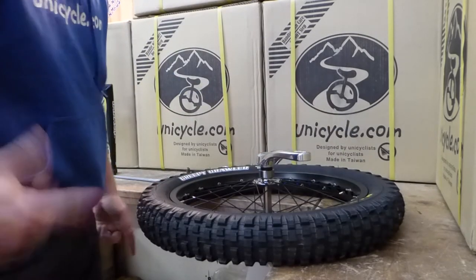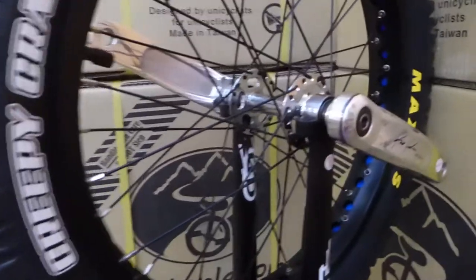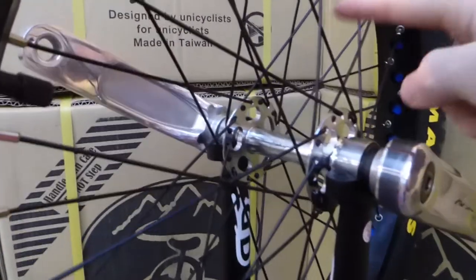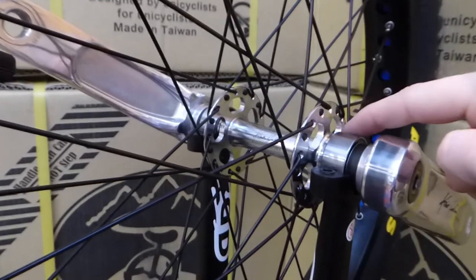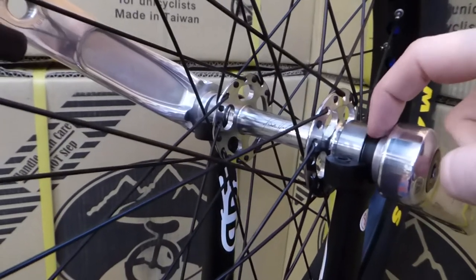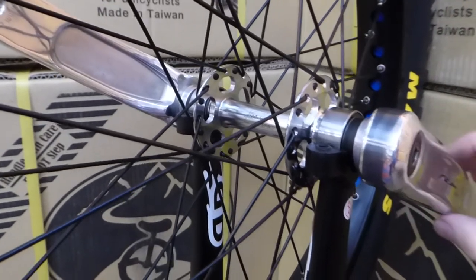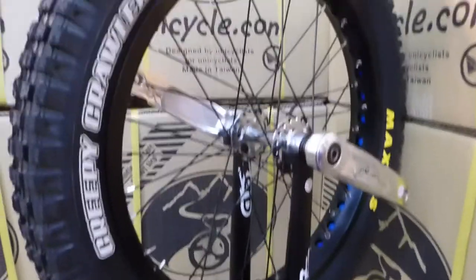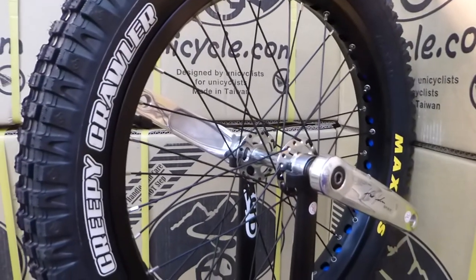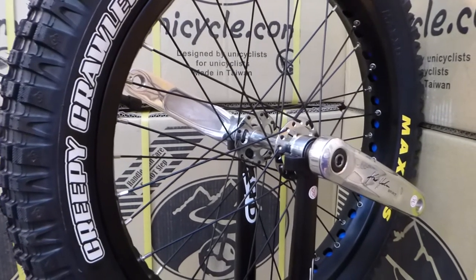I'll go ahead and do the other side and then we'll fit the frame on. And there we go — we've got both crank arms fitted. So what we've got is a Chris Holm wheel set with a Spirit hub which now has 32mm bearings fitted with the correct spacers, pushing on the inner race, and the cranks fitted so the customer can now run his new Reagent frame. Please comment below if you've got any questions and hit that subscribe button for more videos to come.